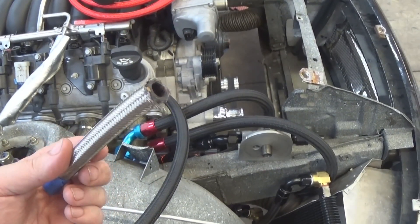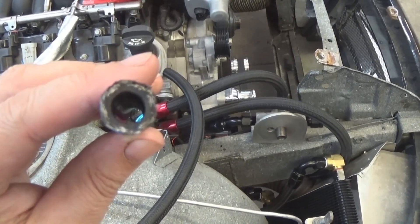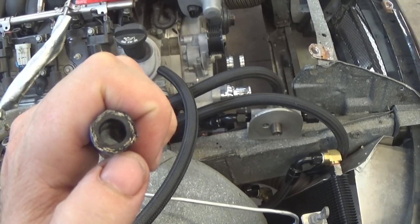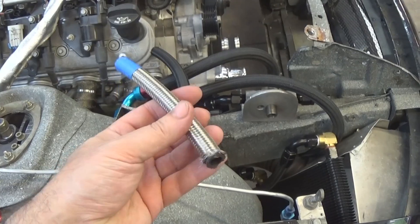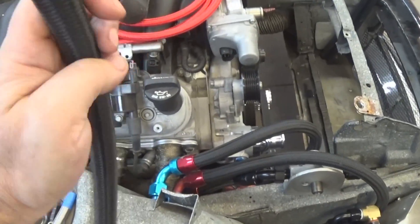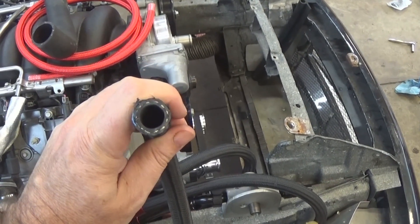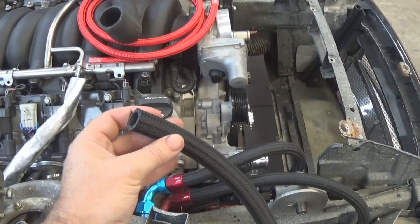The hose itself typically looks like this — this is how a lot of people recognize it, the stainless steel braided hose. I personally like the cloth braided hoses. The stainless steel braided one actually has two layers of stainless steel: rubber, stainless steel molded into the rubber, another outside layer of rubber, and then stainless steel on the outside. It's relatively hard to flex and if it abrades you'll poke yourself on the wires. The cloth version still has stainless steel inside the rubber, but the exterior is cloth. It's more flexible, easier to work with, won't cut you, and comes in different colors like black and red. That's my favorite kind of AN hose.